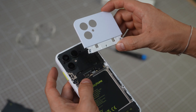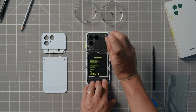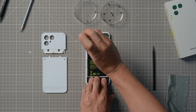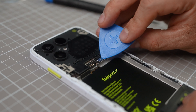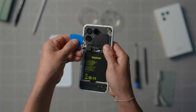And there you go! Now you should see six black screws holding the top unit in place. Slowly unscrew all six black screws and keep them safely aside — you're going to need them later, so keep them in a container. You can now remove the top unit by disconnecting this B2B connector, and then lifting it out using your plastic card or pick.